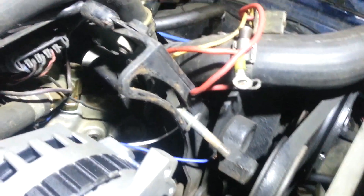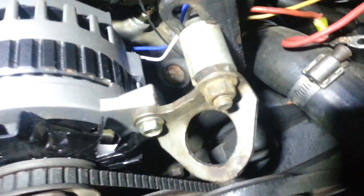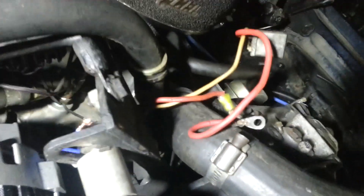I've got a lot of various pieces of steel and bracketry, so I'm going to look through the pieces to find something. I did find something that has the exact spacing to fit the CS-130 to the bracket that's higher up — it's an engine lift for a chain at one end of an IDI 6.9 or 7.3 diesel engine. It works, and it wasn't needed since the engine it came off is gone.